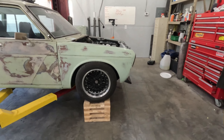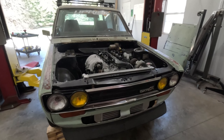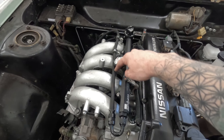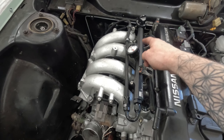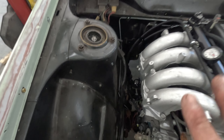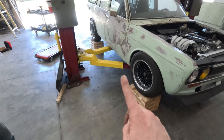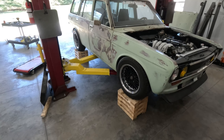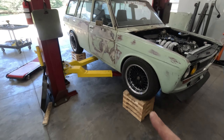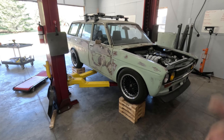Off camera, we did a whole bunch of stuff — you may have seen bits and pieces in the time lapse. From the engine bay side, we kind of finalized the fuel line, fuel rail, and everything. The fuel pressure gauge is installed, the new return line is hooked up, and the feed is done — fuel lines are all buttoned up. Next, the car is on cribbing blocks, so I'm going to slide under there and get measured for a drive shaft because I need to drop it off this coming week to have it shortened and rebalanced. After that, we're going to lay out the wiring harness under the hood and potentially fabricate the gas pedal.